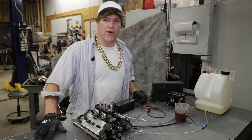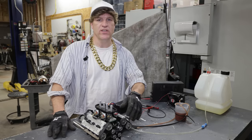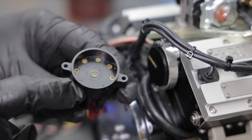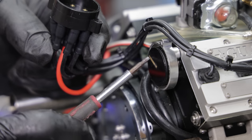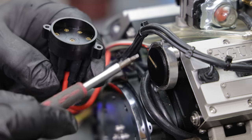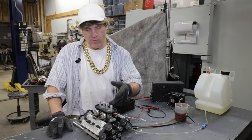That's it. Wow, that was so impressive. Not really. I mean, the engine is really good, but I think personally, the ignition system is weak. That's what's inside the distributor. And this little contact plate right here. So it sparks and then it sparks again, bridges the gap in between the plate and the distributor point right here. And the carburetors are weak.